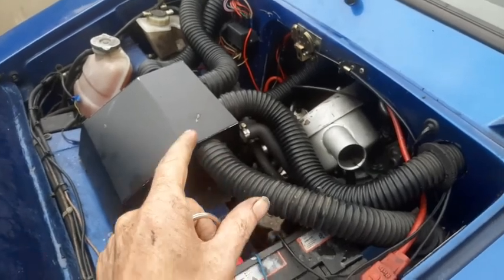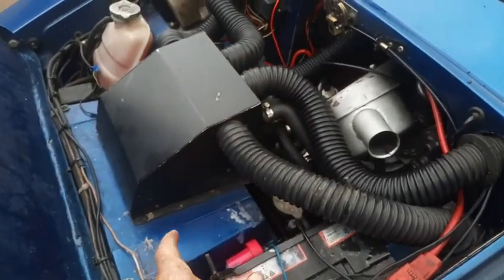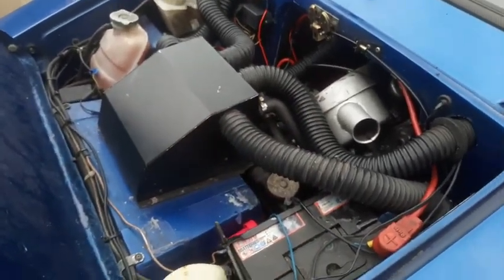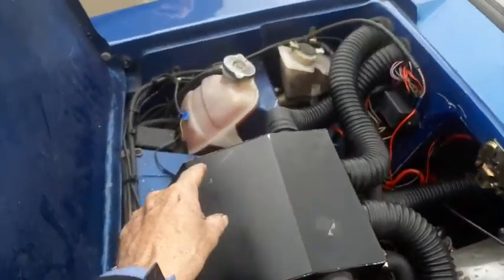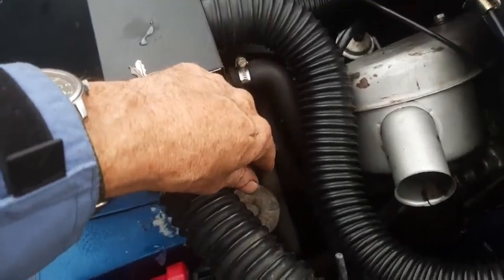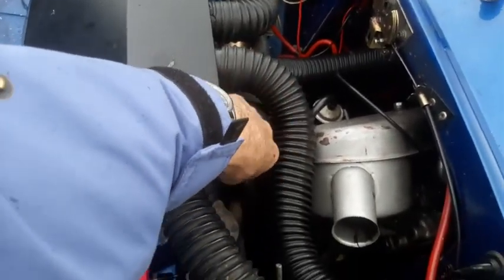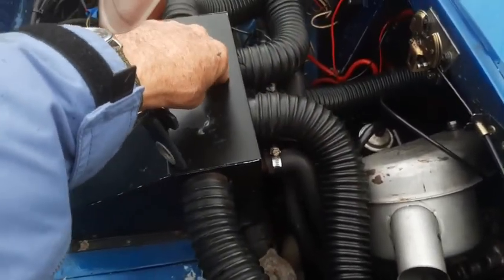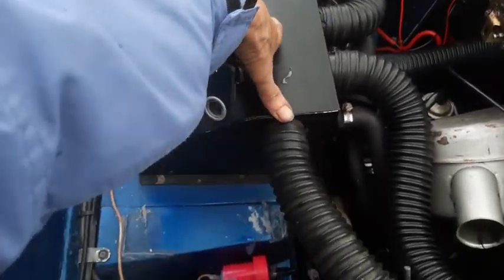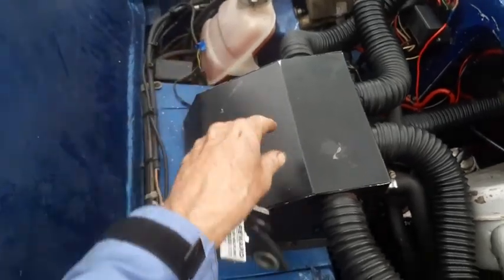And when I finally did get it back, and I'd been using it for a while, then I started getting water problems. It was overheating, then it blew a head gasket. The whole thing was just a nightmare. It was what I call a Friday night car, absolute nightmare. But it never had a top-up tank like this. It just had the radiator, standard radiator like that. And I always thought that was a problem anyway with these, because the pump would have a job to get it up into the heater matrix, causing all sorts of problems. But then they fitted a top-up tank and it got rid of all the problems overnight. Unfortunately, it wasn't on that car, but I'm bloody glad they did it on this one.